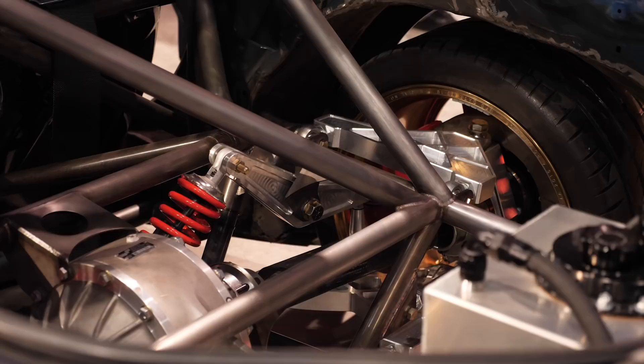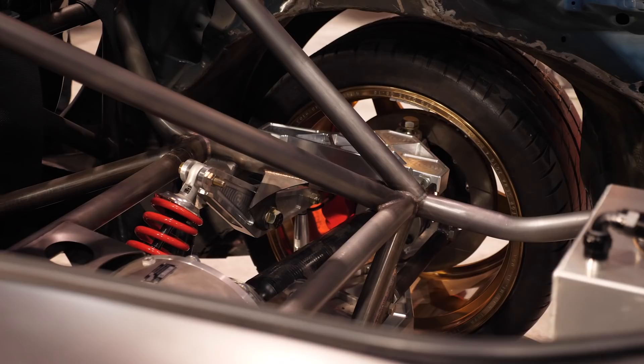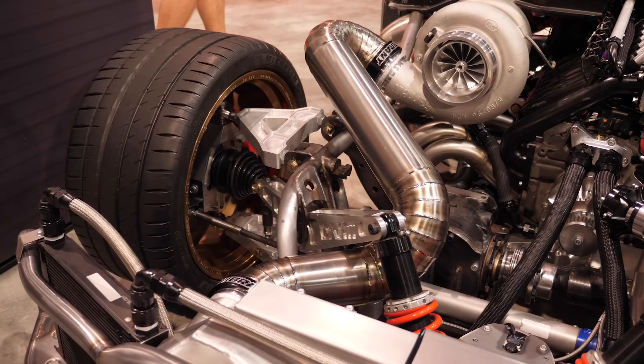Right now the ratios are almost identical — one is 3.64, the other 3.65 — so there's a slight inconsequential slip, but I can turn off the front while testing the rear ratio to feel power band issues. The GTR transfer case isn't a mechanical fixed split; it's essentially a rear-wheel-drive gearbox with a chain drive to the front, using hydraulic pressure to apply more or less drive to the front axle. I plan to run the stock ATTESA system initially, which has wheel speed and yaw inputs, but also want the ability to set it at fixed states — off, 50-50, or 100-0.